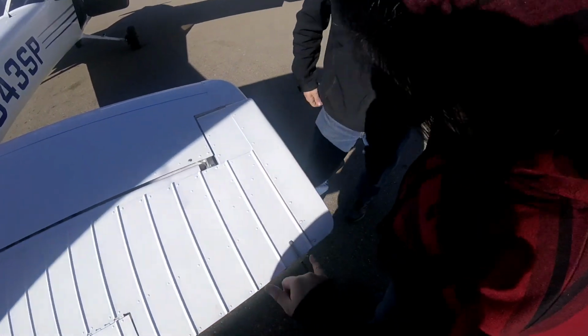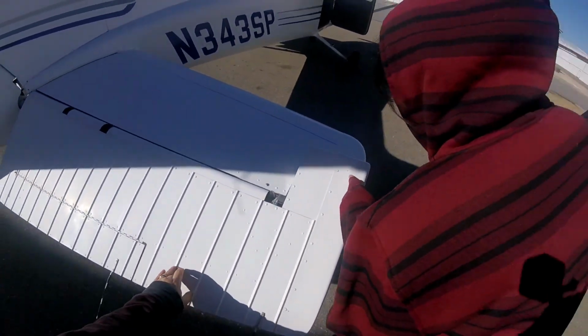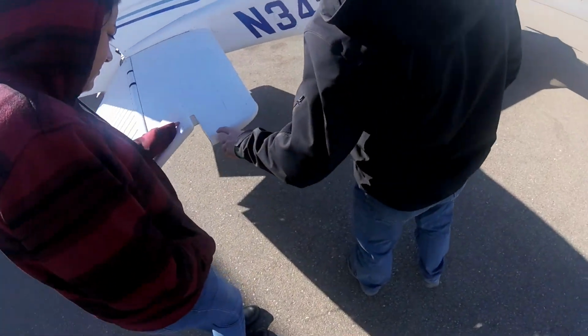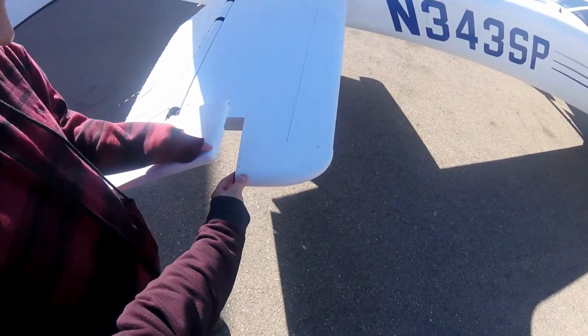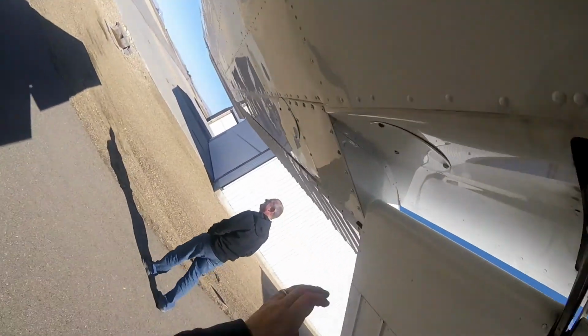So it'll have to happen again. Needs another stop drill. Yep. Yeah, very common to have a plastic crack in Cessnas. Looks like this guy needs a few more stop drills. That one hasn't even been drilled yet. Have to pull the drill out and drill some holes in the airplane. That sounds really good, doesn't it? Yeah. Pretty new tires on it.